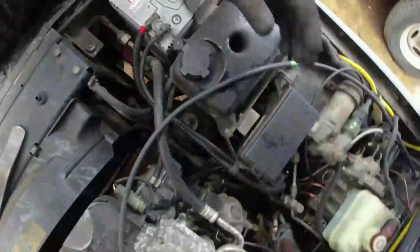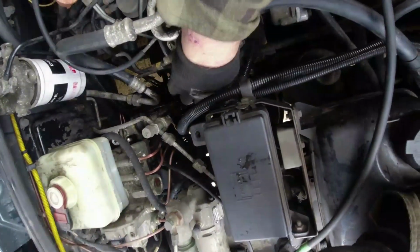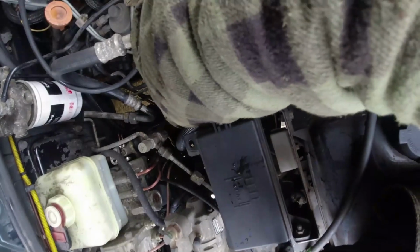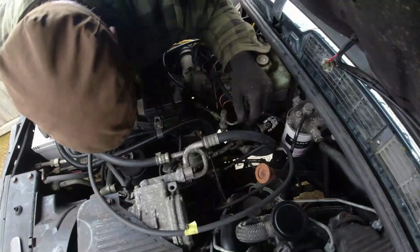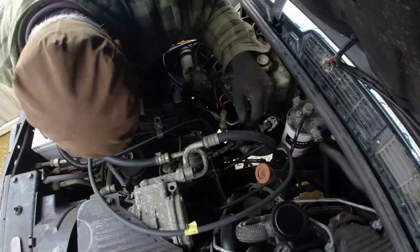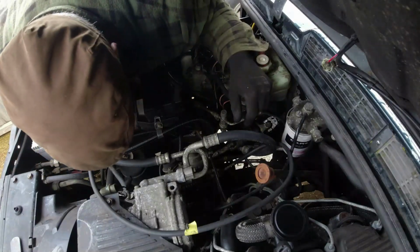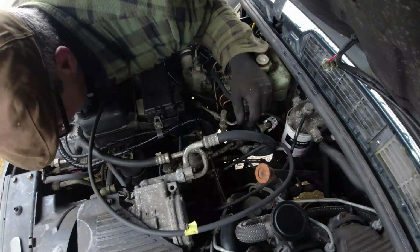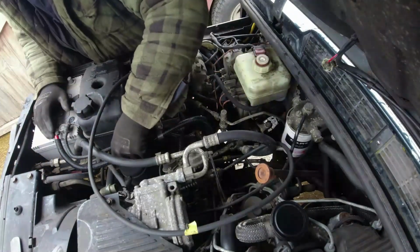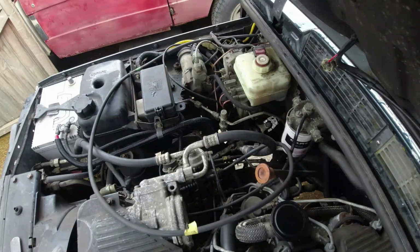So basically, I've got the top joint moving, the middle joint moving, and the lower joint moving, and now the whole shaft is free of the steering box. It can stay like that though. That gives me enough swing room to get the spanners onto the two hydraulic pipes, one of which is partially obscured by the turret here. So we'll try and get the damper turret off next, I think. Let's get sockets. Three-quarter normally.